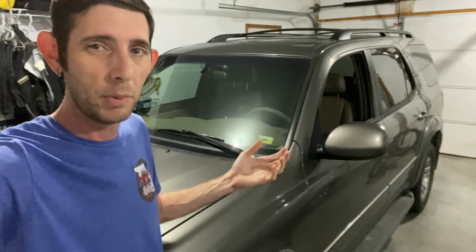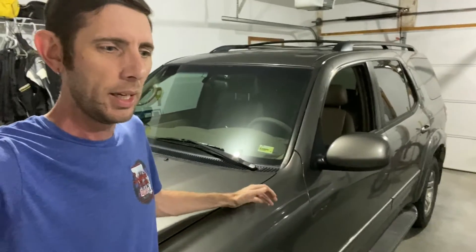I've seen these lights several times in the past. Typically anytime there's a check engine light — when I have a bad O2 sensor or the O2 sensor before that — anytime you've got an engine running condition it turns your traction control off as well. So I've seen those in the past, but this time there's no check engine light. It's just the ABS, the VSC track, the VSC off, and then the parking brake light and it stays on.